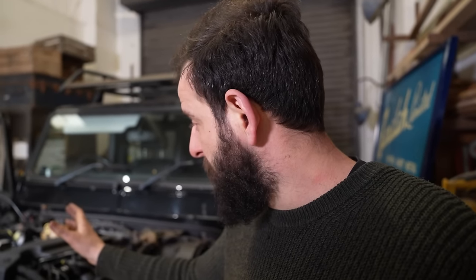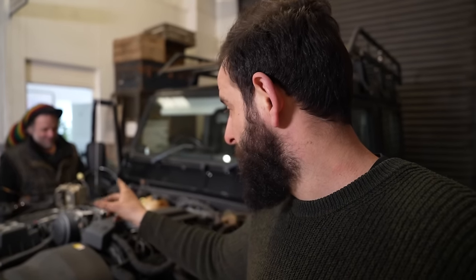Do you want to do it? I've just saved the day, basically. John was getting all upset because he couldn't fit it in. I loosened the 6 bolts holding the pedal box. That's now given that some movement. And now you're about to watch that slide out the way and receive the ABS pump just drop in the slot. Seamlessly. And John chose not to film any of me actually working on it. Well, okay. It did happen.